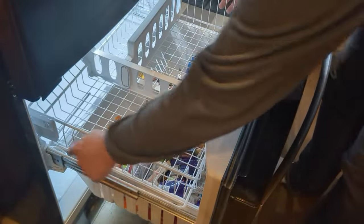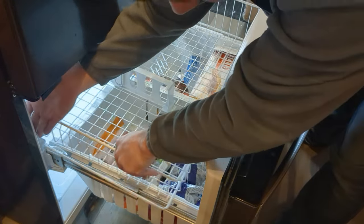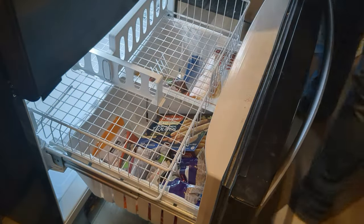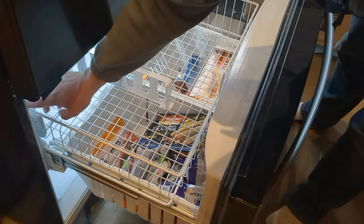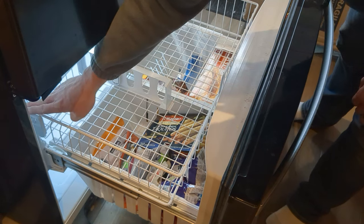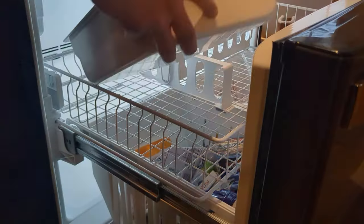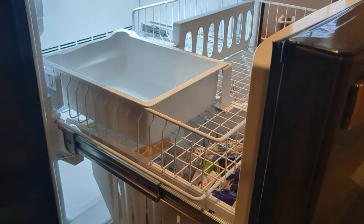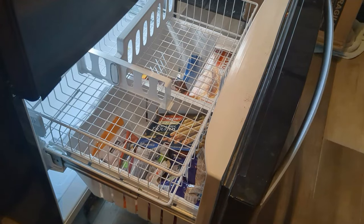When you're ready to put the top rack back in, just line up the bottom rails of the rack with these plastic pieces, pull up on them, and insert one corner then your other corner. Before you push it all the way in, push these rear brackets back down so that they snap into place. Then you'll need to reinsert those front screws. I'm going to go ahead and replace my ice tray and then push this back closed.